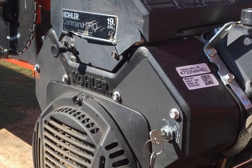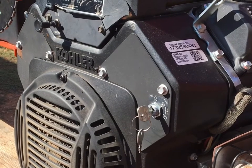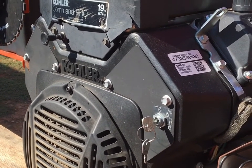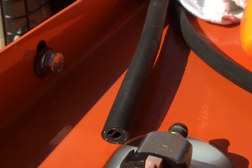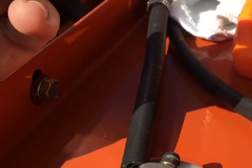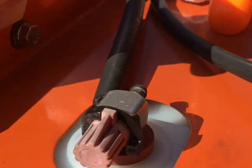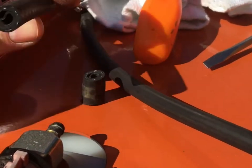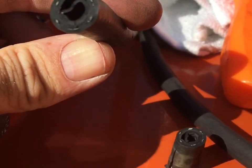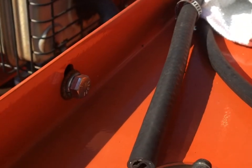I don't know that that is my issue — it's not a very old motor, and like I say, it does seem to run fine. We'll do that as a last resort if this doesn't fix our issue. But for now, we're going to fix the fuel lines. I did blow through the line from this direction — this end went to the fitting — and it did blow some air through there, but I didn't know that this was actually collapsed until we cut this piece off. We had to cut it because it was stuck to the fitting. So I'm fairly confident that's going to be our issue. We'll get that replaced and get back with you shortly.